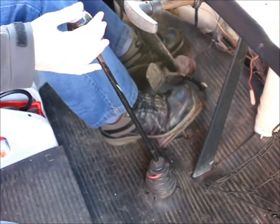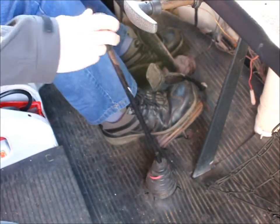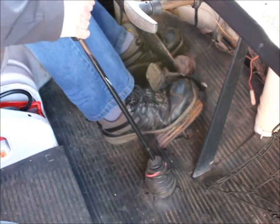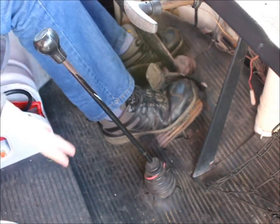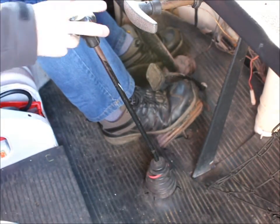Make sure you can select all gears. The campervan uses a traditional H pattern of first, second, third and fourth, and then a longer second push down and get across into reverse. Any problems here and there may be difficulties with bushes and linkage which may need replacing.